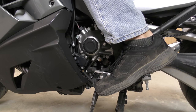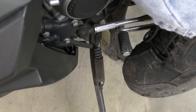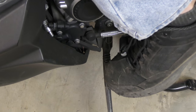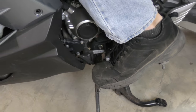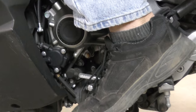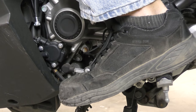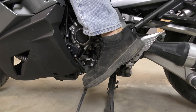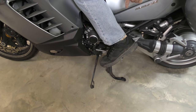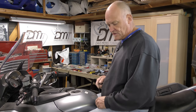It's also on my big toenail, and that is no good. When that's bent straight, it might actually be in the right position so that I can naturally shift. The other part is it's way too high. It's way less than 90 degrees — I'd prefer the shifter at the top of the stroke to be lower, and it's not. So I've got to change that shift rod, pull it off, straighten it all out, and change the shift rod to put the shifter down because that's not going to work for me at all.